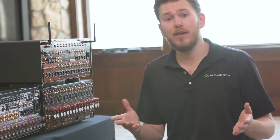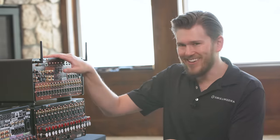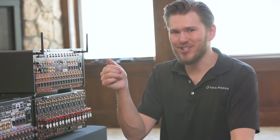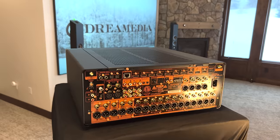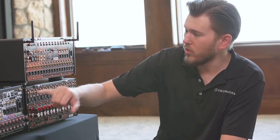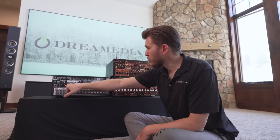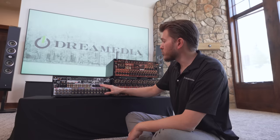So what you would do is take your trigger cable right out of the amp control into the input on the Amp10. Then whenever you turn on your AV10 — or better yet, through HDMI CEC — you can turn on your projector or TV and it's going to turn on the AV10 and the Amp10. Everything in series will automatically turn on. Love that technology built into HDMI these days. Before that, we had to use old-school flashers, emitters, and a universal remote. Moving on, we have remote control in and out on the AV10, but that's not available on the A1H AVR. We do have an RS-232 on both units, and we actually have unbalanced as well as balanced XLR pre-outs on both units — again, really nice to see XLR connections on the AVR, since most all-in-one units don't have that ability.